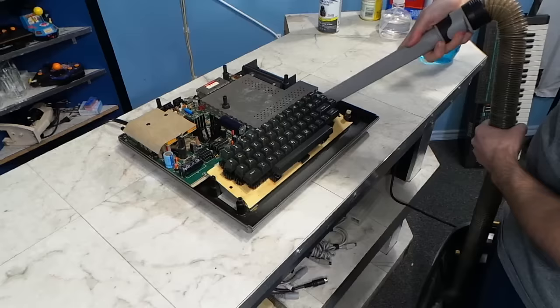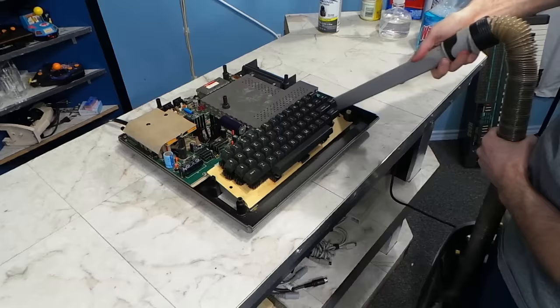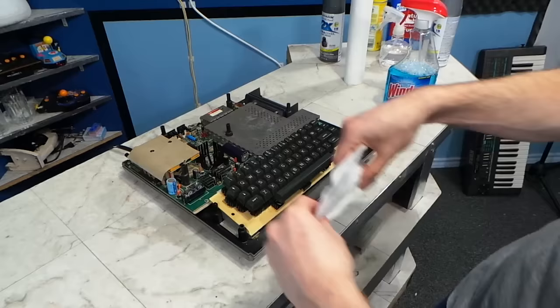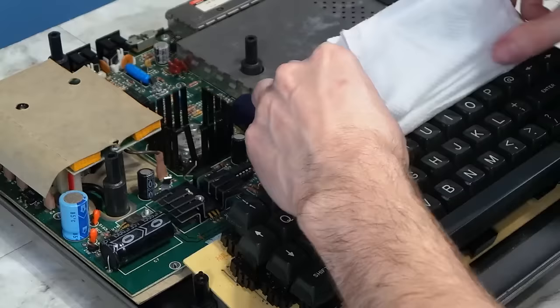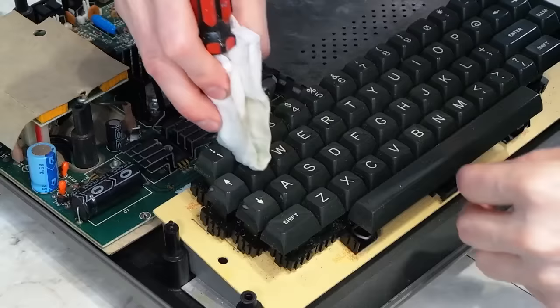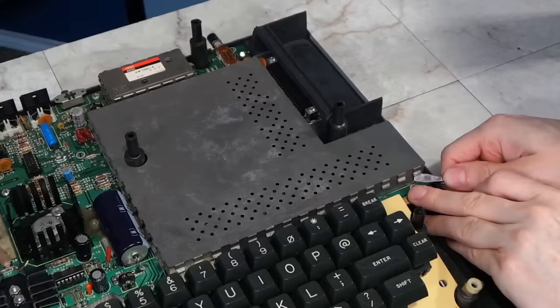In the meantime, I thought I should clean up the bottom half of this computer — it's really not that bad, it just has some dust collected on the bottom. I decided not to paint the bottom plastic for the time being; I wanted to see how the top piece turned out first. So I just vacuumed out the dirt from the bottom and then proceeded to clean the keyboard. Even the keyboard was really not that dirty, so rather than popping off all of the keys like I normally would, I just used another method I've used many times — I use Windex to clean off the top of the keys, then fold the wet paper towel in half and run it down the horizontal spaces between the keys, and use a flat tip screwdriver to help run the wet paper towel between the vertical spaces.